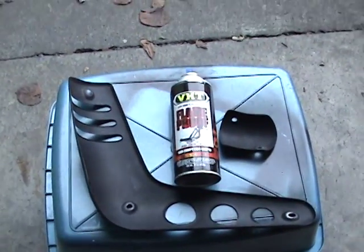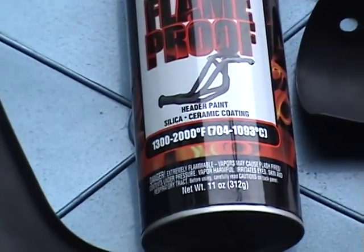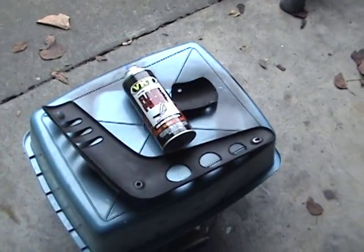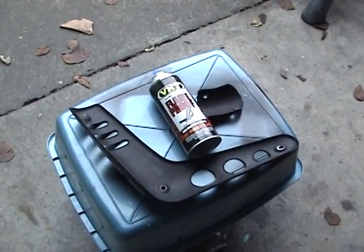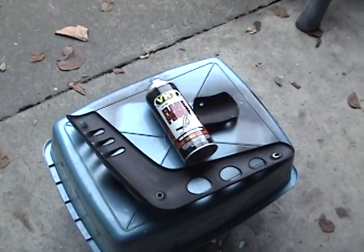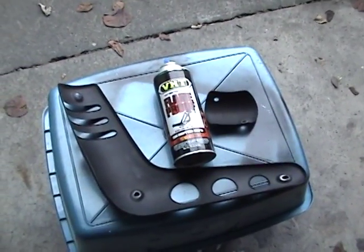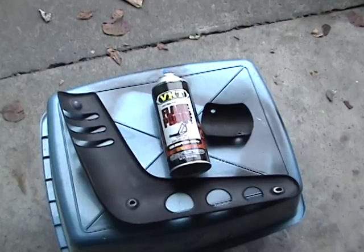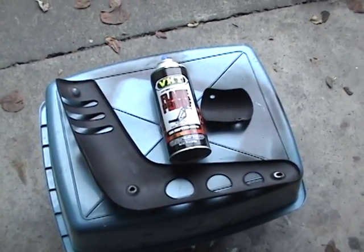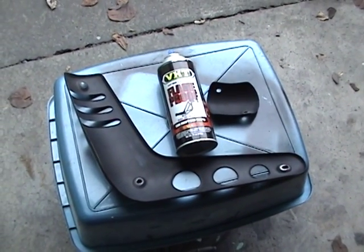Here's my first attempt using this VHT flameproof 2000 degree header paint, and this is flat black. Now I've decided I'm going to check this out before I go and do all of my muffler with this stuff. I'm going to see if it works on the muffler guards themselves. And if it does work, then I can just go ahead and paint gloss black over the top of this. But this will give me an experiment before I do